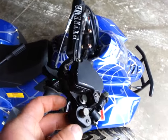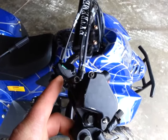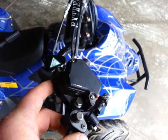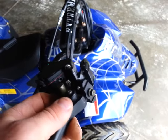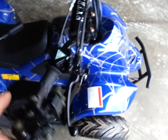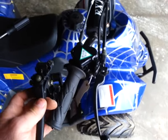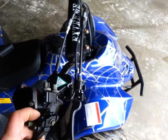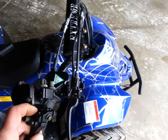The reason we're talking about the housing is because if you haven't broken your throttle control or something else there, it's a lot easier just to swap out the levers — even if you buy the whole assembly — versus having to try to get this grip removed, taking all the cables loose for your throttle, if that's not needed and not necessary.